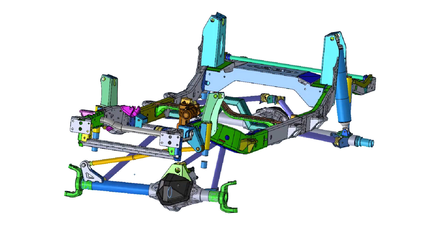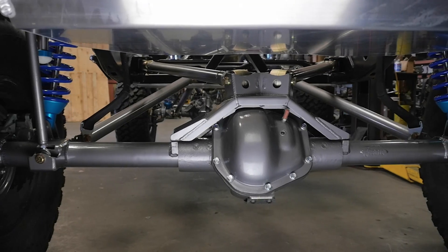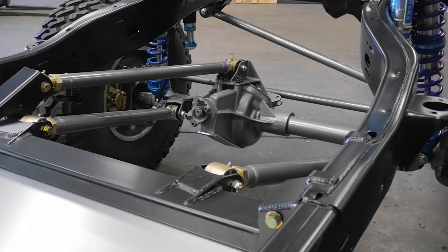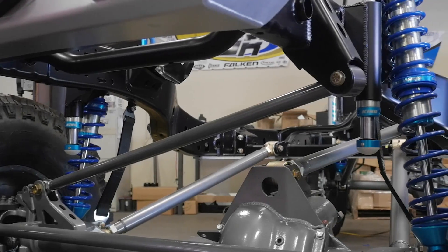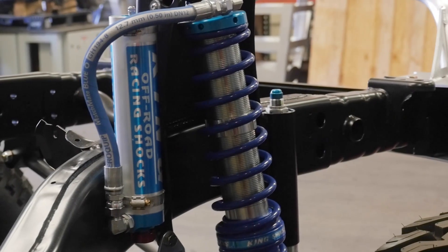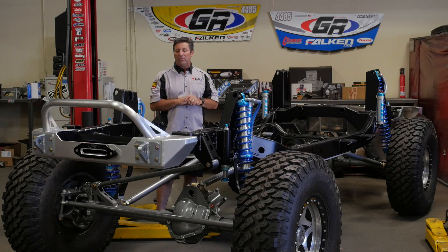This is a complete system including shocks, axles, control arms, everything. This is a double triangulated rear and a three-link front that's got really good suspension geometry. We've moved everything outboard so all the spring and dampening control in the front and the rear is moved as far out to the wheels as we can get it. We're using a giant 2.5 King shock on here with a dual rate spring, and this helps so you've got your initial ride into your full travel harder spring, and that's going to improve the stability and predictability of your vehicle.